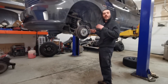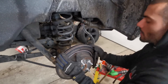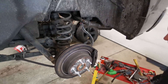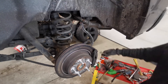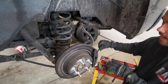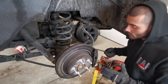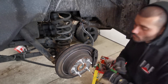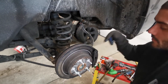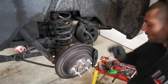We're here in the left rear corner of this truck, wheel is off. We're going to start by depressing the brake caliper — you can do that with a pry bar going through the hole on the side. I've already done that to confirm that my caliper does in fact float. If it doesn't, you need calipers, which is a whole other story not in this video. We're doing pads and rotors on the back of this 2016 Ram. There are two 10-millimeter head bolts that hold on the caliper — take those off.